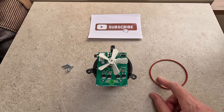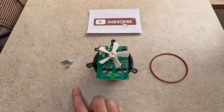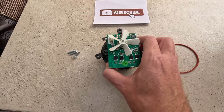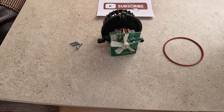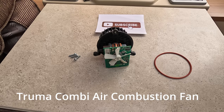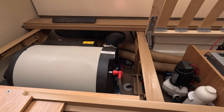This is the new part — it has an O-ring that needs to go back in place to seal the unit. When you get the replacement kit, you do get the screws to go with it as well, so you can use the new ones rather than your existing ones. Make sure you also put in the new O-ring rather than reusing the existing one. When I spoke to Truma they said that 99% of the time when that error code comes up, it is this unit that fails.